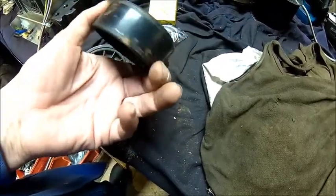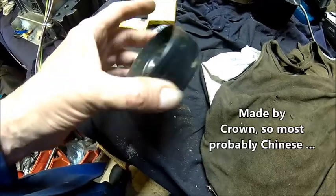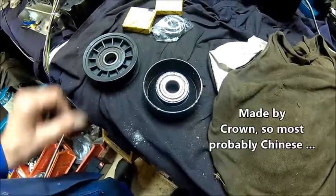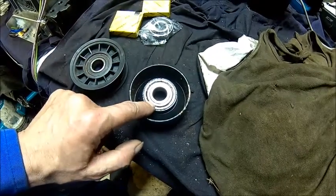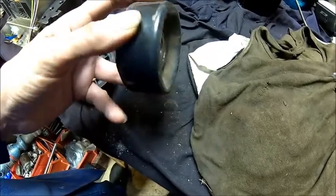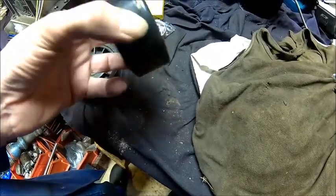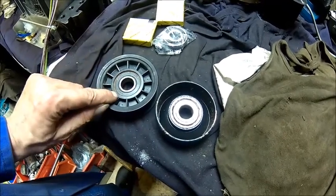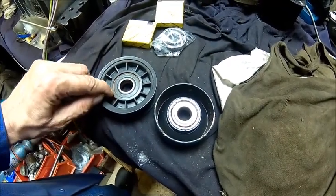I think this is not the original one. That was an aftermarket one I bought, and it only lasted a year or two. So we press that out, hopefully it works, and put new bearings in, put it on the lathe, skim it a little bit flat, and we put that on the lathe as well, and just cut out a little bit of that